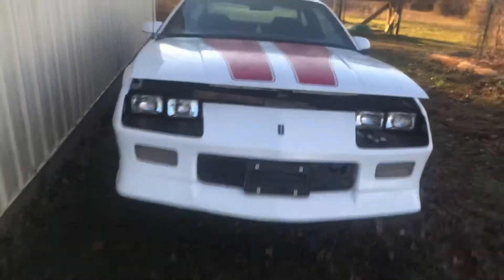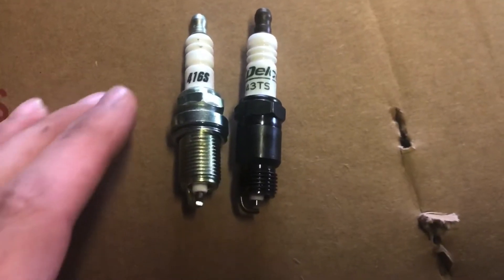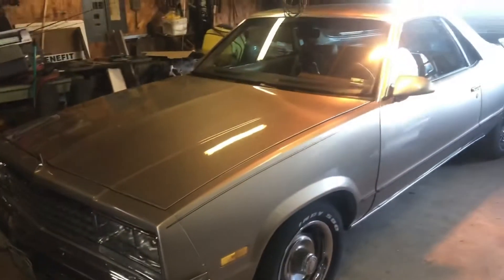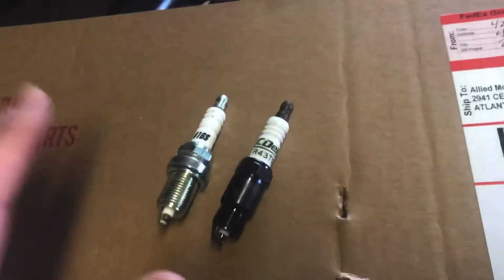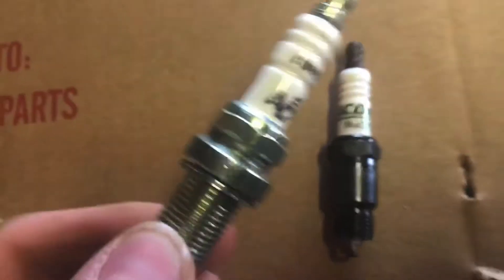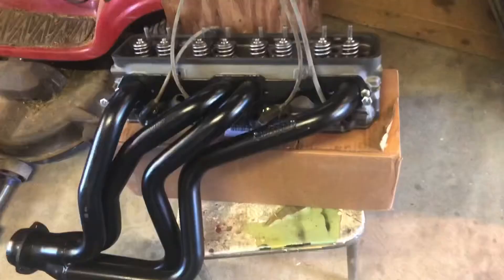Here's a quick comparison of the 4116s plug going into the Vortec heads versus these AC Delco plugs that go in the Caballero. Keep in mind that's a 4.3 liter V6, which has a shorter thread depth, so these plugs are a little different — kind of comparing apples and oranges. But when you put them together, this one is a little shorter. I might post a picture of regular Vortec head spark plugs just to show you, but yeah, I'm definitely happy with what I can do there.